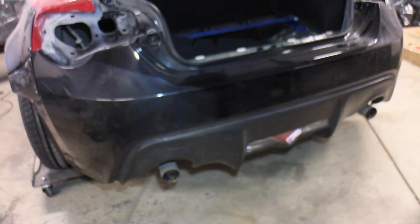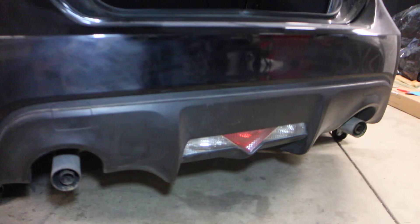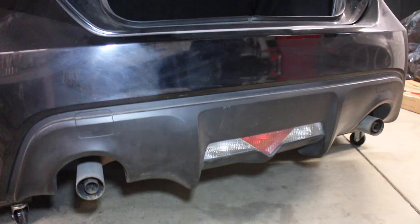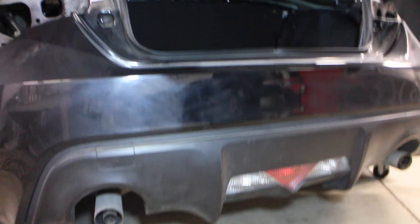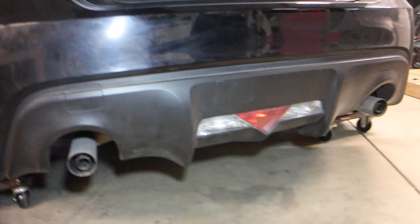We're going to be painting the Plan B in Mighty Car Mods Squid Juice — kind of. The first thing we're going to do is start painting our trim piece on the back because it needs to be black. We're doing black on the trim and the RV kit parts on the bottom, and we're doing MCM Squid Juice on the rest of the body. I like this rear diffuser better than the Rocket Bunny diffuser, so I'm keeping it and painting it black. Since I'm painting the rest of the bumper, this piece has to be painted first and allowed to dry, so I can then tape off the rest of the bumper for the Squid Juice color. First I've got to tape off the whole back of the car to prevent overspray, protect the bumper and the floor, then spray this rear diffuser with our black trim color.